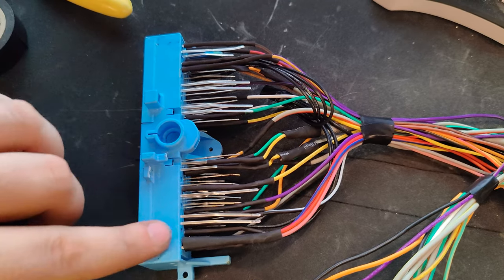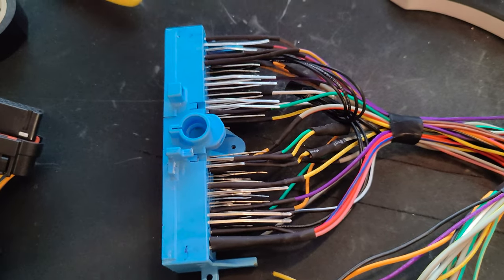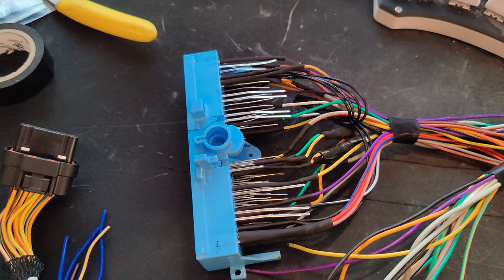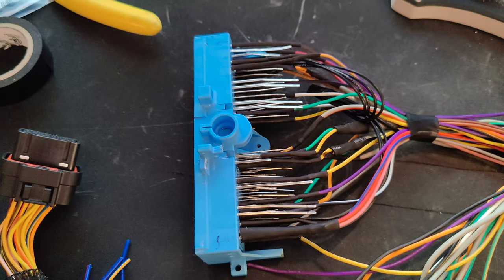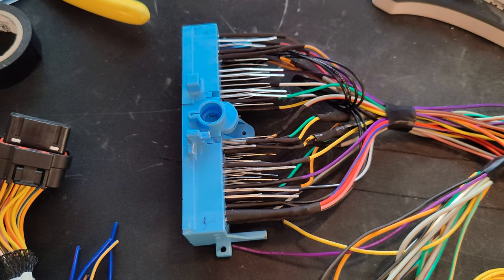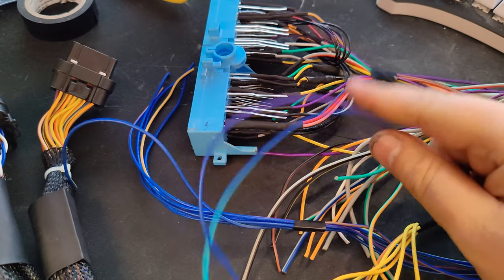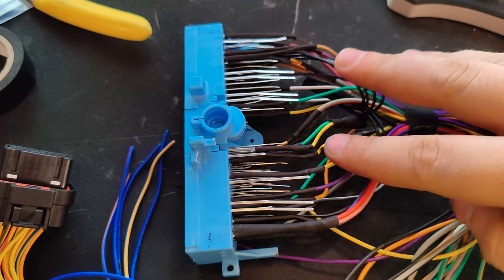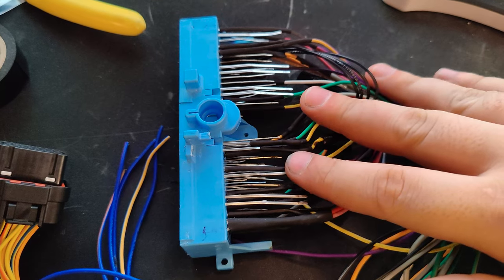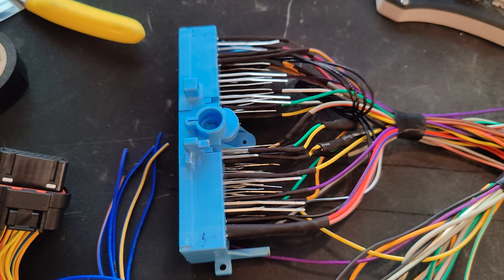When you break this down to its bare essentials, it's actually pretty easy. You can now hook your Haltech up to the ECU connectors, and it should power right up as indicated by the green power light — you should also be able to connect to it with your laptop. This is basically what you'll be doing for a fair bit of wiring for the swap: just soldering the flying lead wires to the back of the ECU connector. I've got just about everything I need wired out of this connector — ECU power, grounds, signal ground, radiator fans, and the fuel pump. Other things like the six injector wires and six coil wires didn't have room on this connector. The spare pins go to things I don't use anymore like EGR or the EVAP system. I reused some things though — this car had a four-cylinder with four injector wires, and I ended up reusing those for the electronic throttle body, which needs two position sensors and two motor wires — totaling four. That just simplifies the wiring a lot.